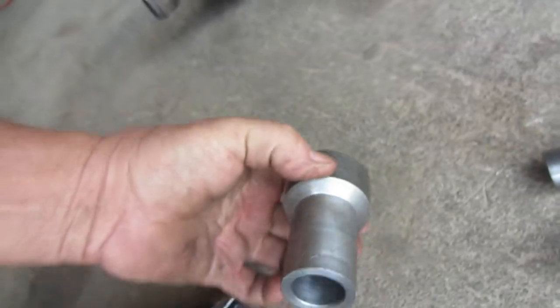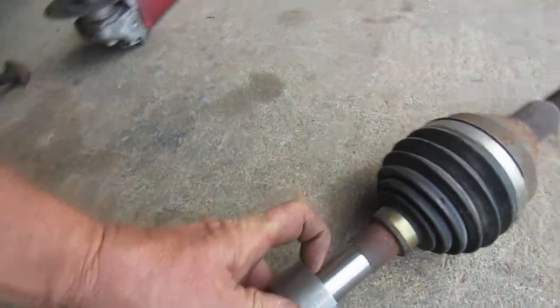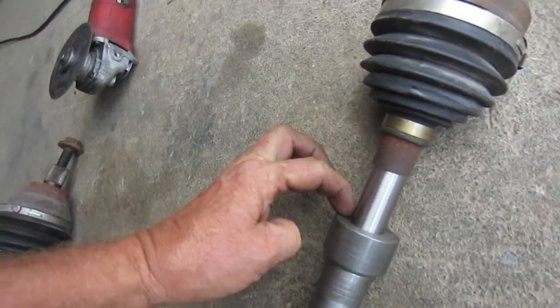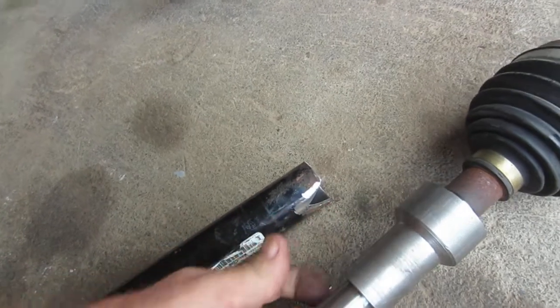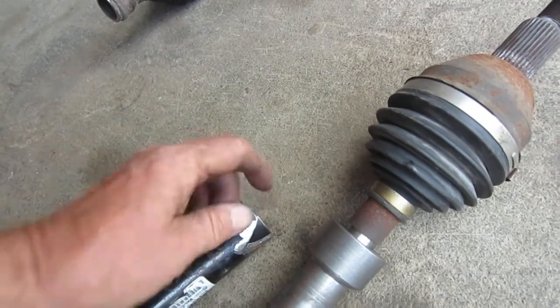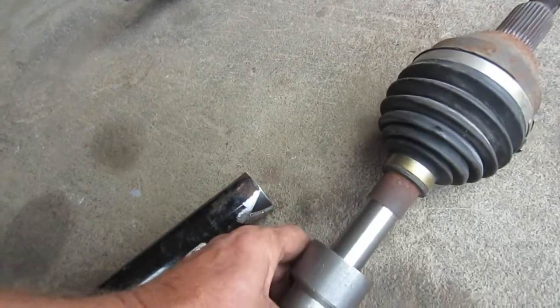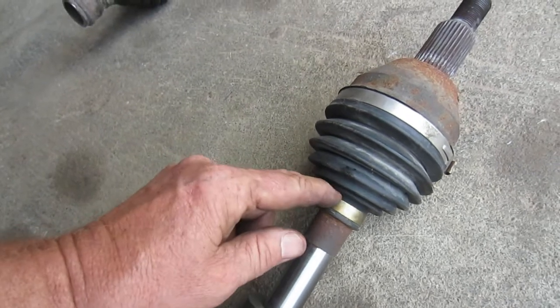This one's a little different — you don't need to cut the V-grooves here, but you do there and there. That's a perfect fit, plugs right in there. The reason I don't need the V-grooves on this one is it's going to be radially welded all around, but when it's slipped into here it'll have another weld. The very first weld I do is there, then when installed the next weld goes around here. It'll be sticking away from the rubber about that far so the weld won't heat up and melt the rubber.